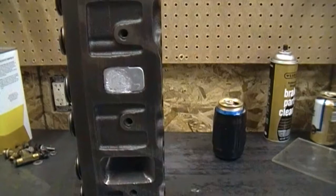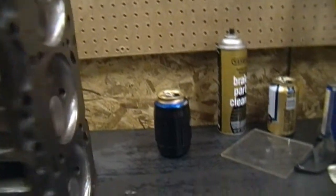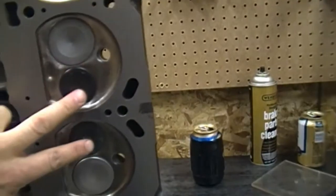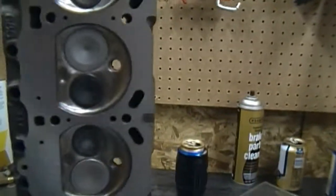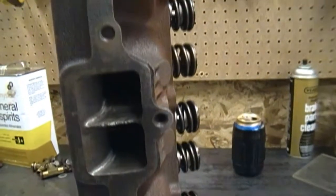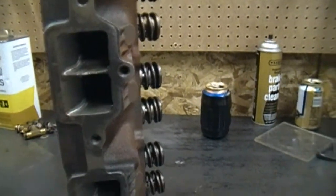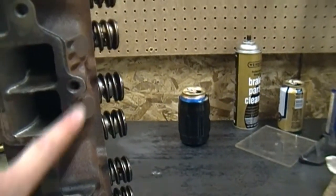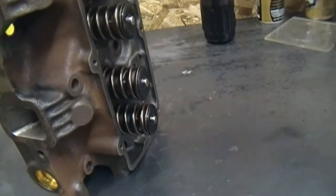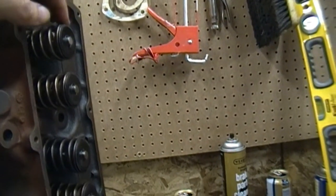The intakes were all done. That there is a zinc plug, and what that does is you can fill it in and actually pretty much match these two exhaust ports. You don't really want to have an exhaust crossover right there. This is what they call a Siamese port - if you're going to be running a header, you want to have this recess brazed in. The manifolds I'm going to run are actually one big port here, so I didn't bother doing that at the time. And these springs are all matched with the cam that's in there. You can't use a stock retainer - you have to have a retainer for that spring and the correct keeper.